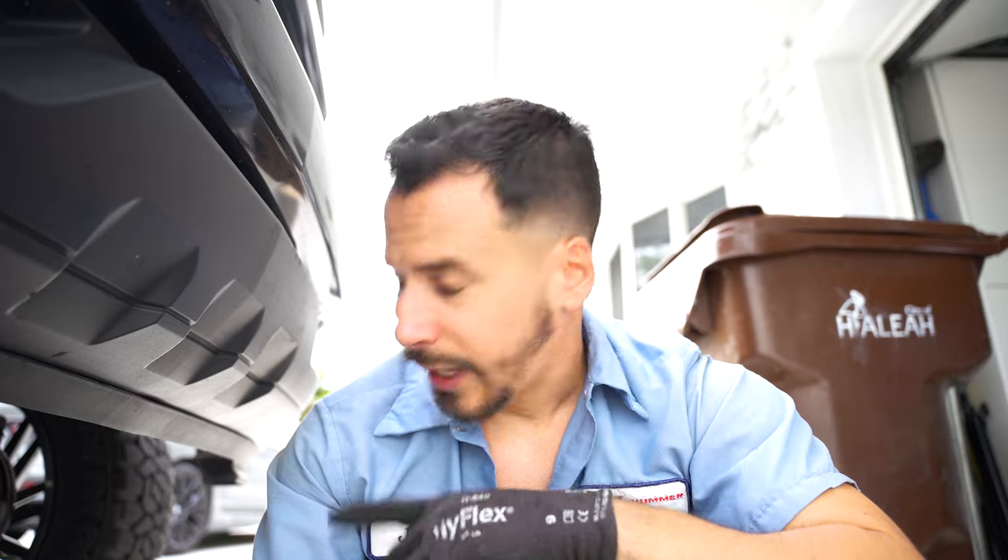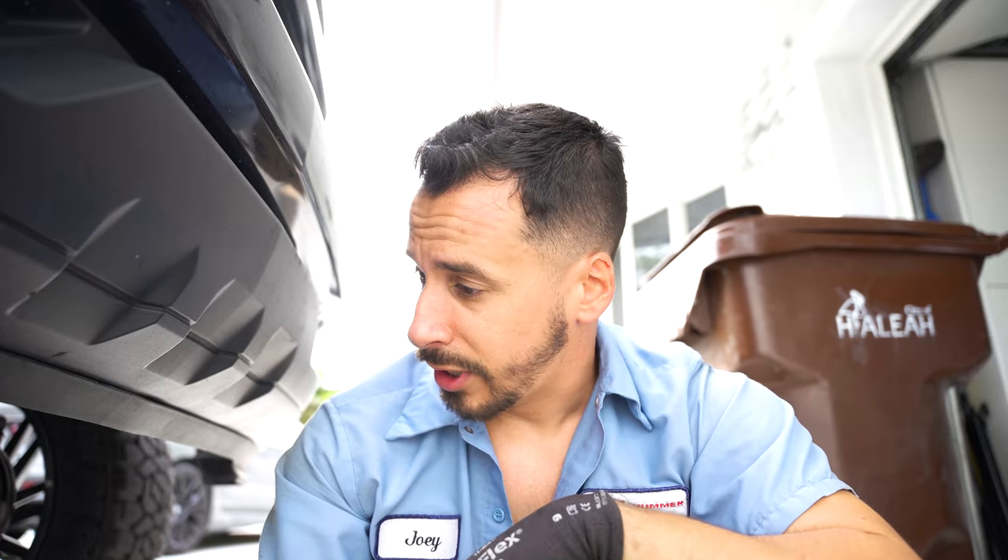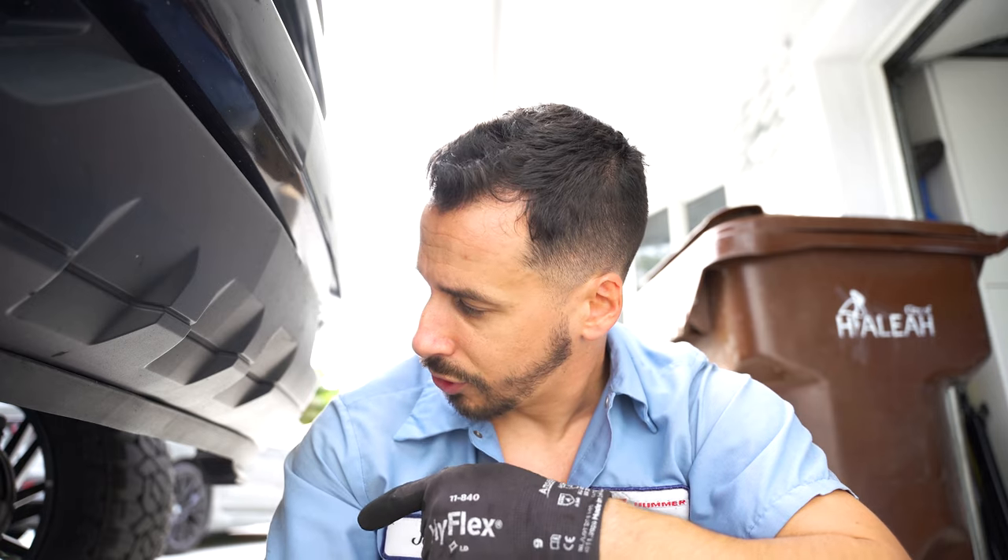Alright, so I've loosened up the vacuum pump for the brake system and it had quite a bit of oil — more than what it said it should have inside. So definitely if you guys are going to replace this part, I recommend just putting in an oil drain to capture the oil. I used cardboard and it didn't really work out, so I had to switch over to an oil catch. I did not remove the steering shaft, which some people recommend for easier access. So now I'm just going to fiddle it out of the passageway and install the new one.